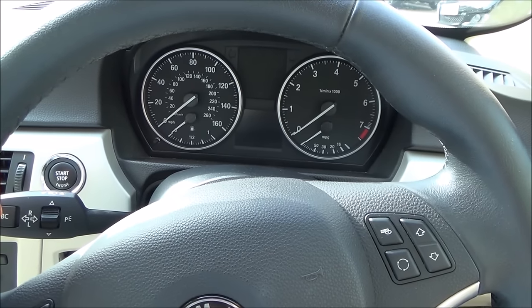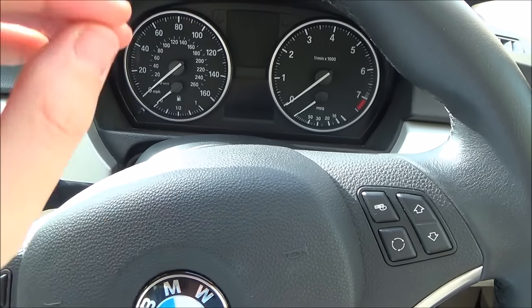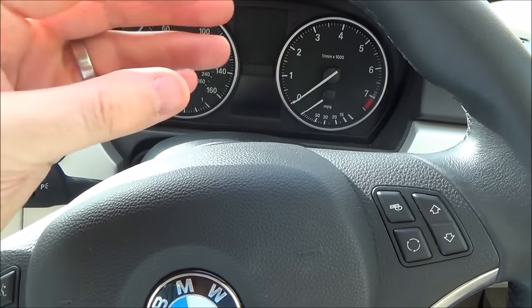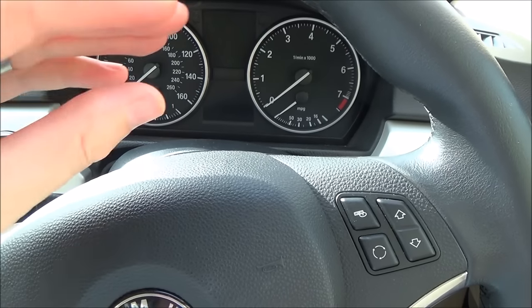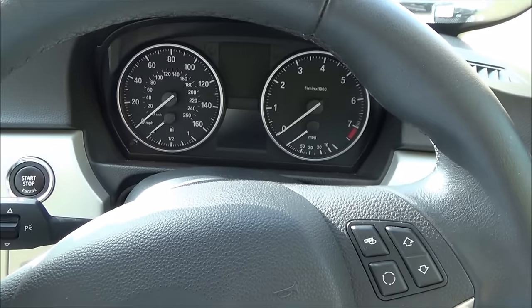You should be checking your oil at regular intervals, but on this particular car the oil level has dropped. Sometimes when I turn off the ignition it bongs at me and comes up with the oil lamp symbol in an amber-orange colour, which just means the oil is low. If it were red, that would mean low oil pressure, but in this instance it just means low oil.